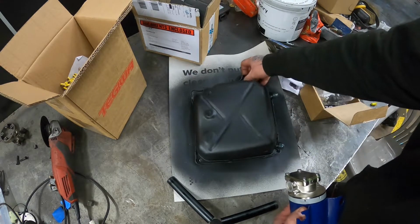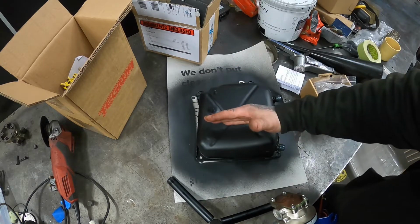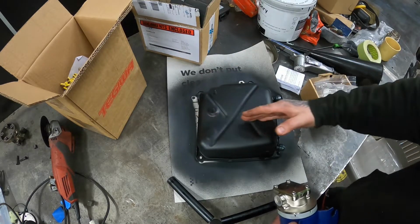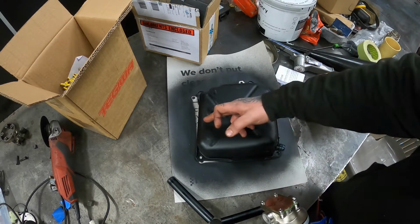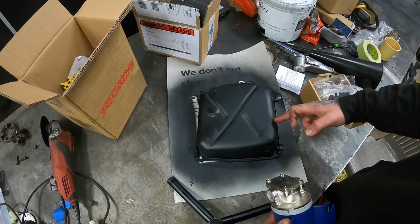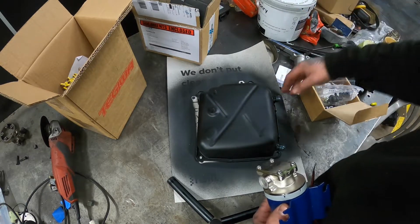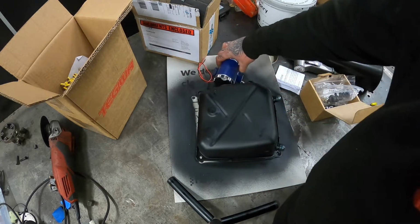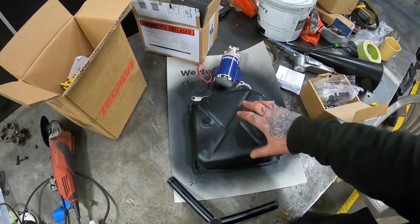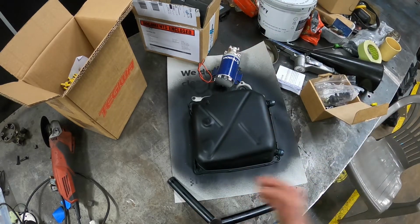So obviously the sump goes that way on, this is the top, that's the bottom, so this is where the oil is going to sit. I don't know exactly where it sits, but I would estimate inside the sump pan it's probably around this level, somewhere here. So it'll just be constantly taking oil out of here, going around the system, and then dropping back at the top. It's going to mean the quantity is a little bit higher, but that's not a problem. But yeah, this is the sump, the pump, and then we'll move over now.